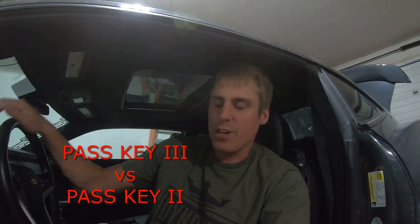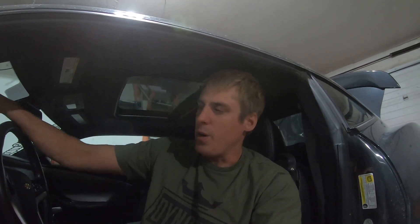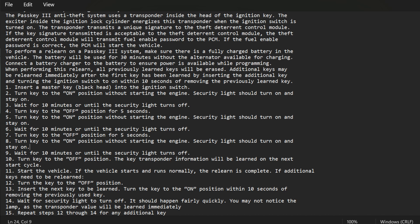Click on the T43, click Retrieve Current VIN again — that should pull the correct VIN if the T43 was programmed correctly before. Then click Copy Current VIN Over, do Update Check Digit, and then you can flash or update that VIN number to your ECM. One difference with the van file regards the immobilizer system — it has a slightly different system. The very first time I flashed this van file the car wouldn't start. What worked was the key-on key-off method: key on, wait ten minutes, shut key off, count three to five seconds, key on ten minutes, five seconds off — repeat three times. Then it relearned the key passcode and started again. Ever since then I've been able to flash the truck or van file back and forth without issues. If you do swap over to a van file, just make sure you do that key-on key-off method — I'll try to find it and put it on screen so you can screenshot it.